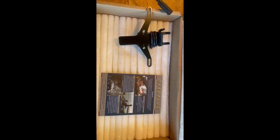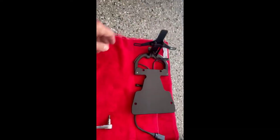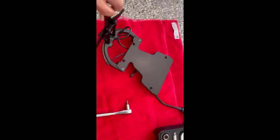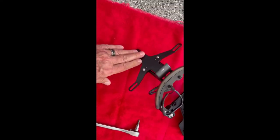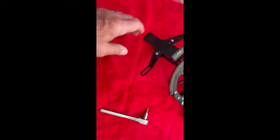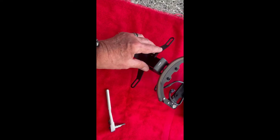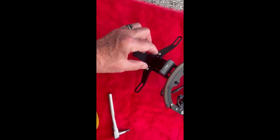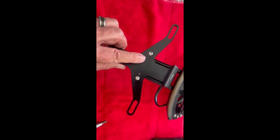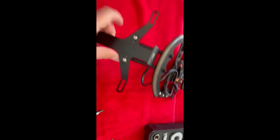The next thing I'll be doing is putting this license plate holder on. And we are back — a little pro tip: go ahead and install the license plate holder before you install the main tail tidy piece. It makes life a lot easier. My Torx wrenches aren't quite long enough, so I had to take these pieces off, then this piece comes off. Then you can take a little two-millimeter hex wrench to take these off so that these freewheel, and then put some Loctite on these two, cinch them up, and put it all back together. Makes for a very nice and tidy tail.